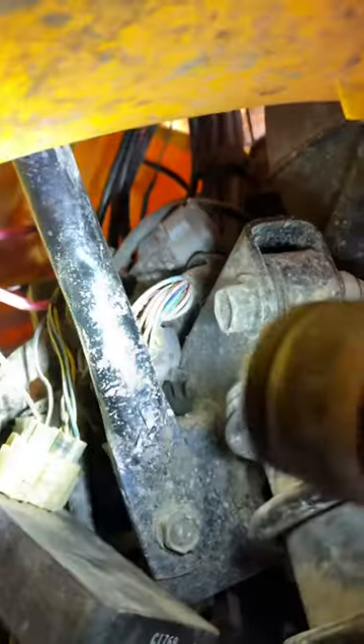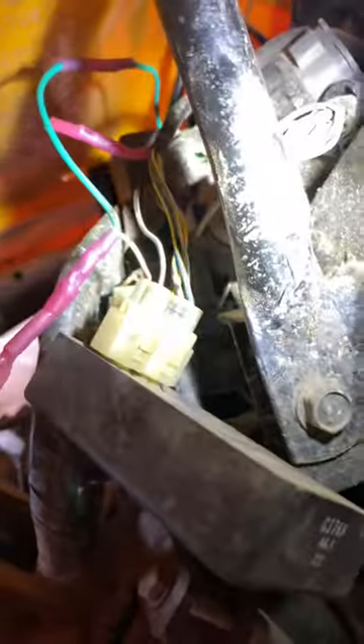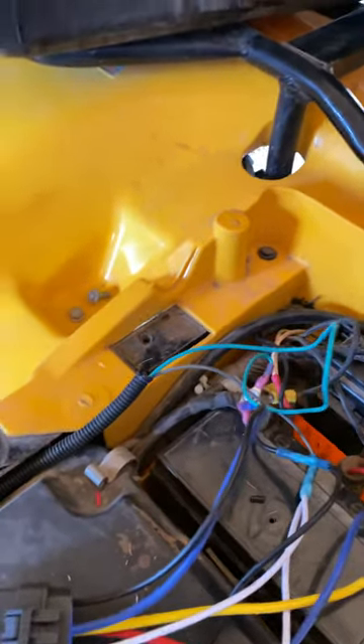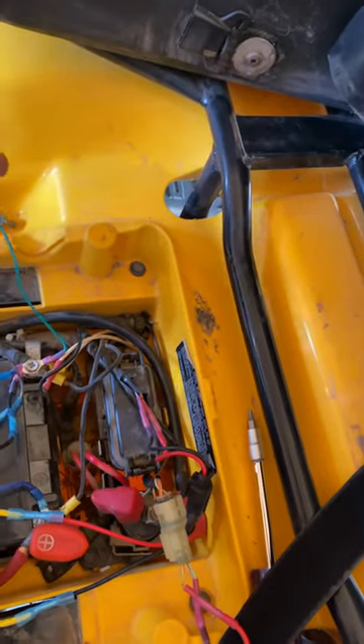What I did is I cut that greenish-blue wire right there — it's a bluish-green color with a red stripe. I was experimenting, that's why there's a butt splice hanging off the side. I cut that, and the other half is this wire right here, and I ran that green wire all the way back to the four-wheeler's ground terminal. This green wire comes back to here.